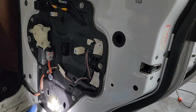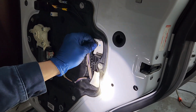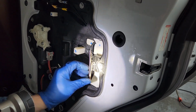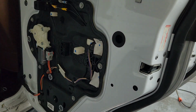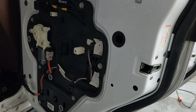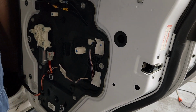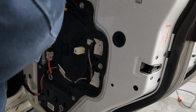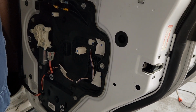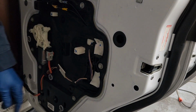But what I have to do right now is cover those back up after I reset the glass. That's the important thing there, is resetting the glass. Okay, so you can't see it right now, but I'm gonna take these suction cups off and take this wedge out, and then I just let the glass click in. You just heard it. The regulator bar is actually up there right now.